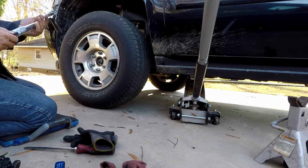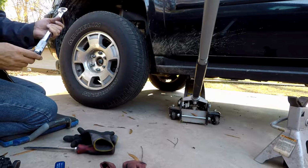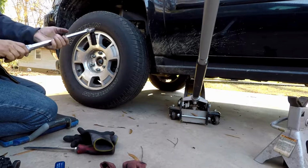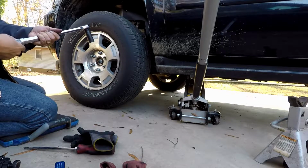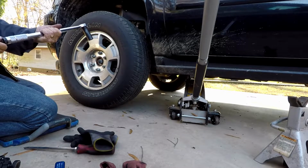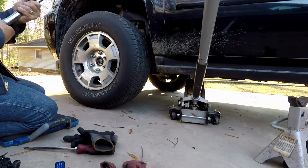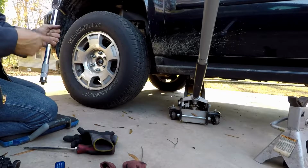these down. Now the poundage for this, and I'm not going to show you how to adjust this, the poundage is 140 foot-pounds for a 2007 Tahoe LT. So I'm going to set this up for 140, and that is almost maxed out. This goes to 160. There's 140. Lock down the tab so it won't turn on me, and then we'll go to tighten it.